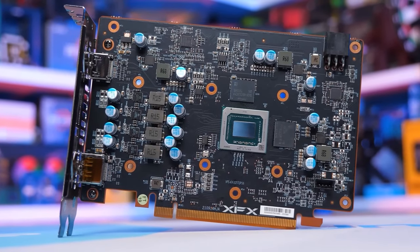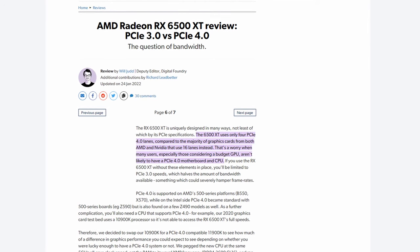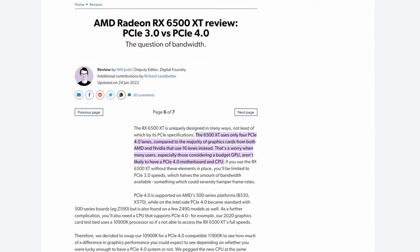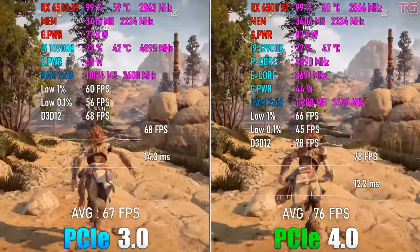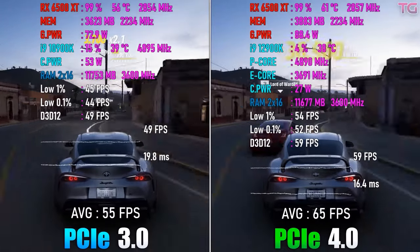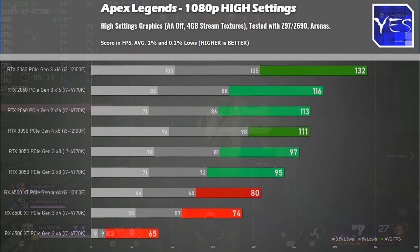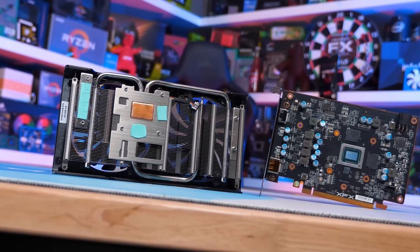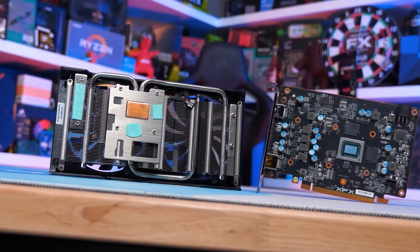But this is not the case with cheaper cards, and the most notable example is the RX 6500 XT with 4 PCIe lanes and 4GB of memory. When connected via PCIe 3.0, the card will rely heavily on your system's RAM, which will increase the load on the bus, which is already slow enough. This leads to the fact that the frame rate difference between PCIe 3.0 and 4.0 can reach 20-30%. And of course, connecting it to PCIe 2.0 makes no sense at all. You can lose up to 50% of performance, and that while the card is not very fast in the first place. Thus, now you should also keep track not only of what version of PCIe you have, but also how many lanes your graphics card has, which can be a huge limitation for cheaper solutions.